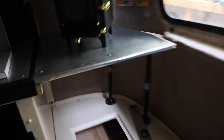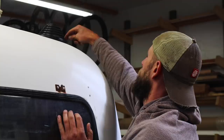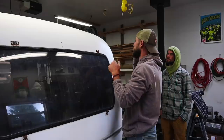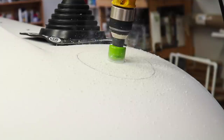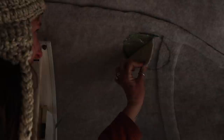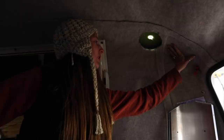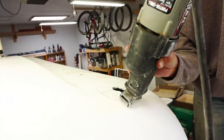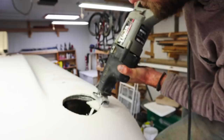The next plan of action was cutting the hole in the roof. To make the hole in the flattest place on the roof while staying safely away from any combustibles inside the scamp, we pushed the stove as far forward to the front of the countertop extension as possible. Dave drilled the first hole from the outside of the scamp using a one-inch bit. From the inside I used a compass to make a perfect circle and cut out that circle of fabric. Dave was the first person to ever sit on top of the scamp — he used a sawzall to cut slices from the center to the outside ring of the circle, then cut off all the slices. I cried a little bit during this part but he did a perfect job.